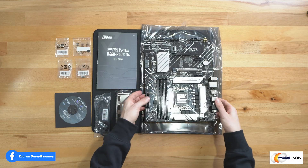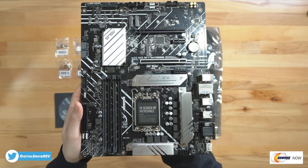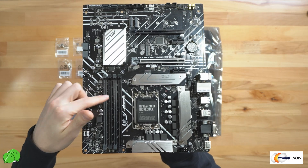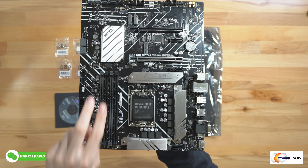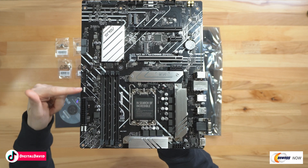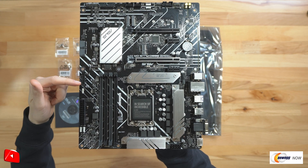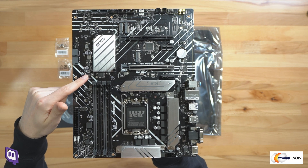And lastly you can see the board itself right here — everything looks great. You can see our four DIMM slots right there for DDR4. You're going to start with the two gray ones first if you're only doing two sticks of RAM. You can also see a lot of different headers right here, including USB 3.0, and you can see how that looks with a USB Type-C connector.